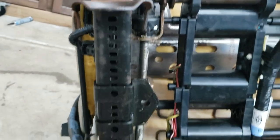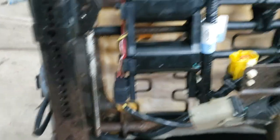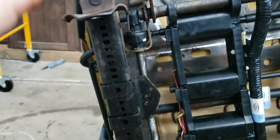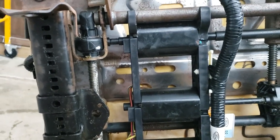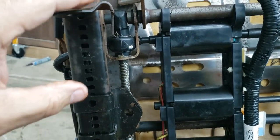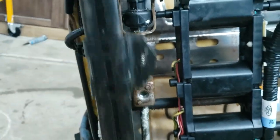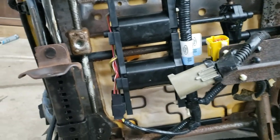With the seat sitting up, I sprayed brake cleaner down through the track to clean it out — same thing on the other side. Then I used WD-40, sprayed it until it came out the bottom. The tracks were moving very stiff, which was also causing that twisting motion — one side was moving a little freer than the other. I took a hammer and tapped it down and up with the WD-40 to free it up. After that I pulled them all the way down and packed white lithium grease inside the track. Now I can move them with one thumb — up and down, both sides, moving freely again.